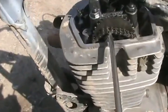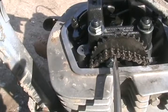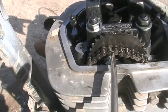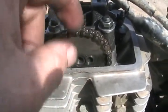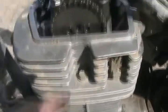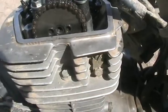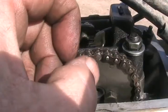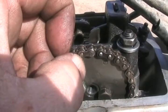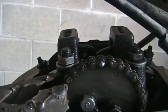With the screwdriver just pressed against that little H-shape link, I just tap the back of the screwdriver with the hammer and it pressed the pin all the way back in. And the chain is almost as good as new. I took the two little bolts out, sort of dropped the sprocket down by pinching everything. Line the chain up - cam is on TDC, piston is on TDC - and now to put the bolts back in. And it should be ready to rock once I adjust these. The bolts are tight now. And now for the weld - that's the trickiest part but it should just take a second. Done. Just took a wink of an eye. There's the little blob. It's just fine, it doesn't get in the way or anything.